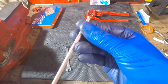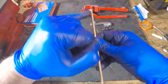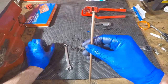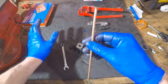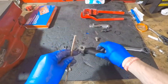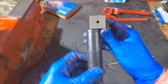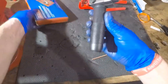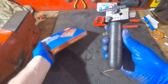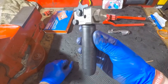Now if you try to do this with that other tool, the head of your flare is always cocked — it's never really straight. You can get it straight, but it takes a few attempts, and by that time you've already messed up your brake line and it's probably not going to be long enough. So yeah, the best ones you can invest your money in are a little bit more expensive, but get one of these handheld ones — I'll try and put the link in the description. It's a no-brainer: leave those alone, they're absolute rubbish. Buy one of these — they're fantastic. This one is by Blackline, but there are some non-branded ones on eBay for the same price.